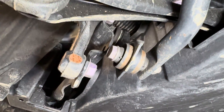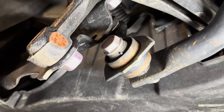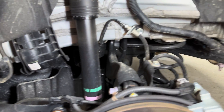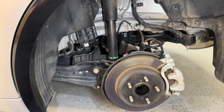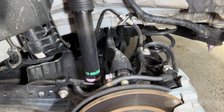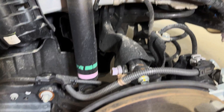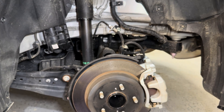Directly behind that link we get a look at the back side of the knuckle, including where that trailing arm mounts along with the anti-roll bar and anti-roll bar link. Looking at this from a performance standpoint, there are a lot of opportunities back here to make changes — and again opportunities to dip into the Toyota parts bin. That rear anti-roll bar looks almost exactly like the unit from the recent Toyota Corolla hatch, so I wouldn't be surprised if they're interchangeable. Dampers and springs are obviously another area where modifications could happen, along with replacing some of these links with adjustable units to be able to adjust things like camber and toe.